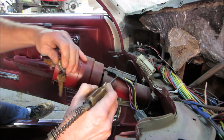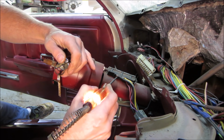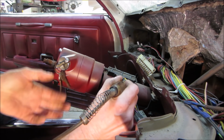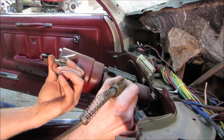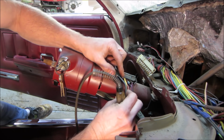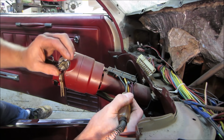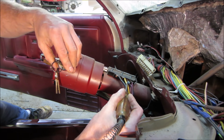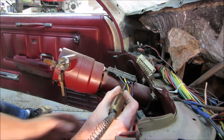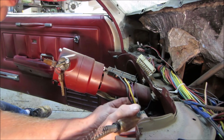That turns on and off. I would think that would be power to the fuse box maybe. And then one of them should be a crank. It should send power out to one of these for crank. I should probably have looked up colors. Oh, there it is. That one's crank right there, but it's not going to the starter. So that is red with a blue tracer.